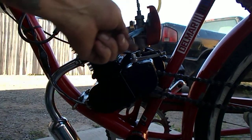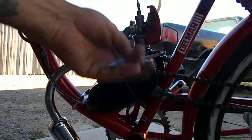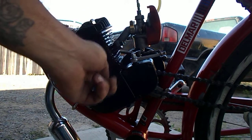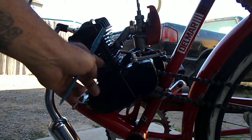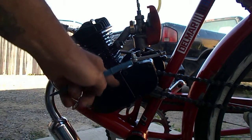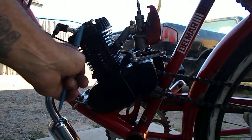This is how it works: the fuel mix runs in down through here. As the crankshaft spins, it sucks the air-fuel mixture in. The oil and gas mix in the bottom of the crankcase, and then as the piston rises up, it slides open a little valve on the side. On the inside it's either a side valve or sometimes there's a poppet valve in the bottom — as the crank goes by, the vacuum opens that little poppet valve and the intake comes in.